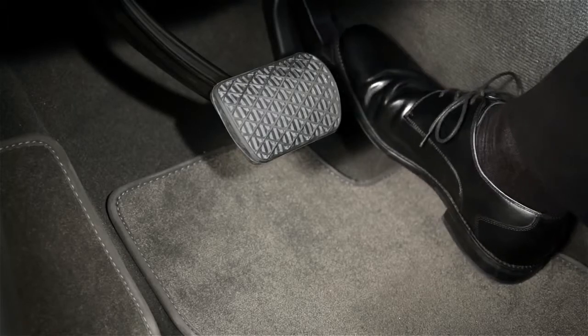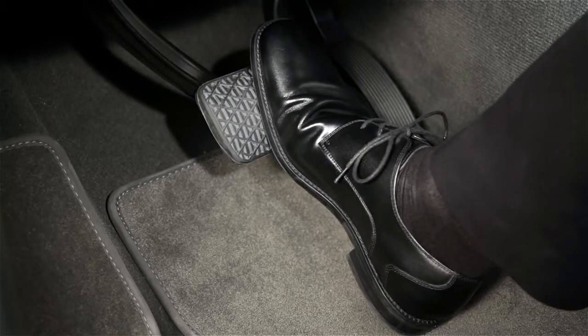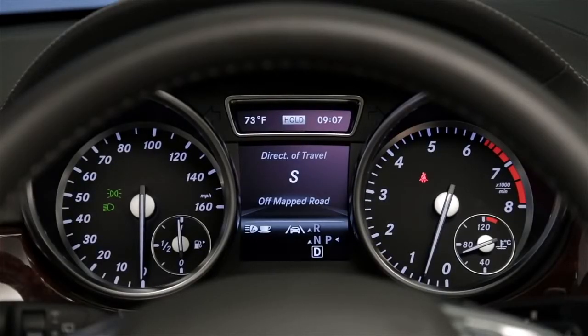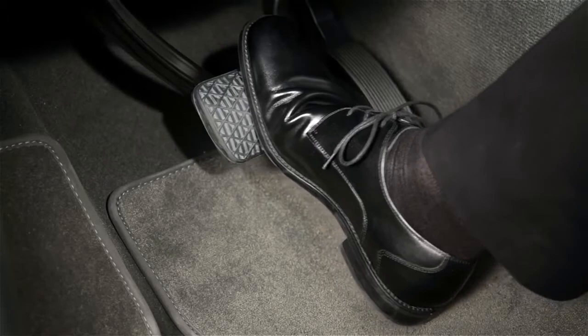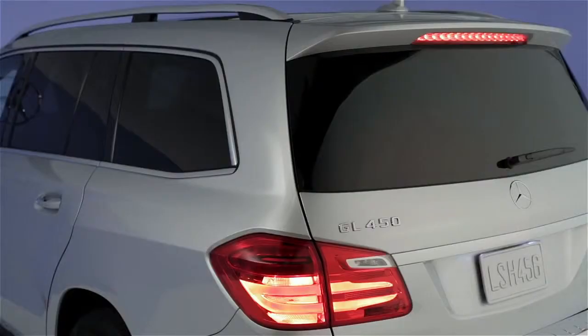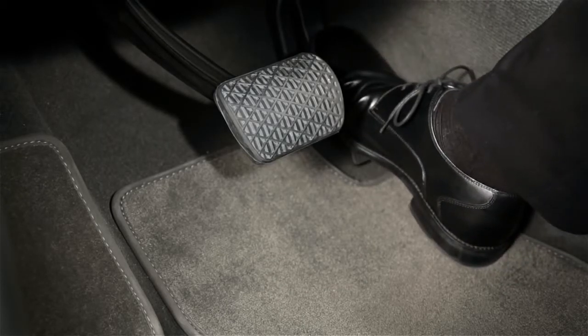To use the feature, first brake your car to a complete stop. Then, with your foot still on the brake, quickly depress the pedal further until the word HOLD appears in your car's in-dash display. You can now take your foot off the pedal — the brakes and the brake lamps will stay on. When you're ready to move on, simply depress the accelerator and go.